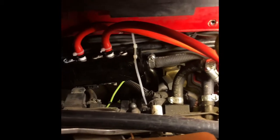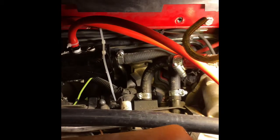It's not like you have to push it on. So it's decently small. Like the 4mm is almost too big. So I can't see it possibly running like a 3/8. You might be able to find some sort of reducer. But if it was me personally, like I did, I would just buy a vacuum manifold and just plug it into it, because eventually you might have other things that you want to do with the car to where the vacuum manifold will pay itself off.